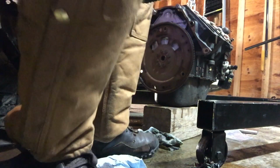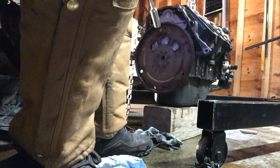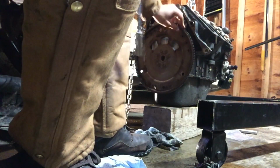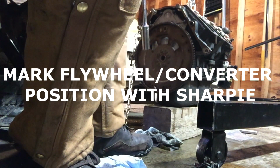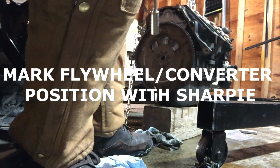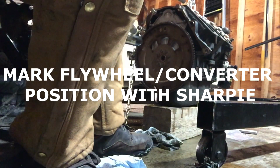So since I'm getting my heads decked, or my block decked, the crank needs to come out. For the crank to come out, I need to take off the flywheel. If you don't get yours decked, then don't worry about this. And if you don't care about your crankshaft roundness, I'm gonna have the machine shop measure all that stuff. So I might as well go ahead and do them a favor, take all that stuff off.